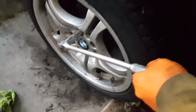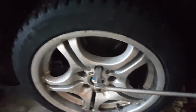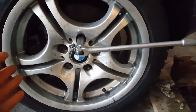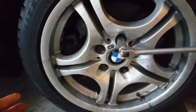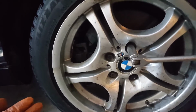So what about if I turn it by tool? It can move. In other words, the car is still very drivable, and the longer the range, the more force you have to put in. That means the more serious it is. So for this, about 1.5 inch at the end of about 18 inches long range, this certainly needs immediate attention, because it is grabbing to the disc.